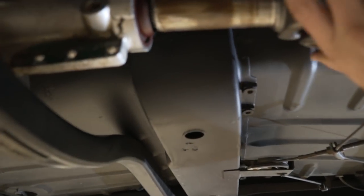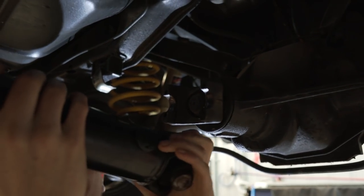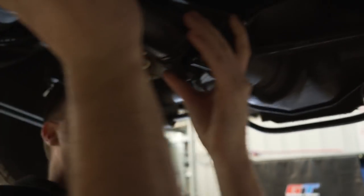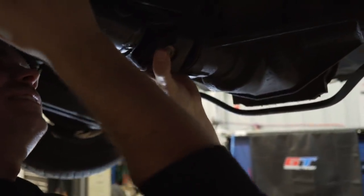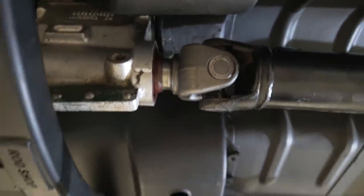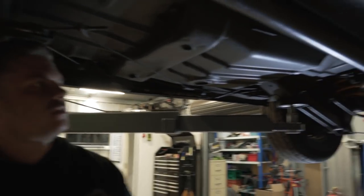It's in! Oh, it's in first gear — make sure it's in neutral. The handbrake is off. So how much slip have we got? It's close at the minute, which is actually the opposite of what I thought. When the diff goes up, the driveshaft actually pulls that way, so you end up with more gap. That's perfect — that should be fine because it's at full tilt right now.